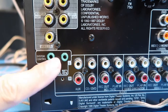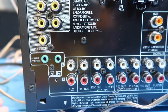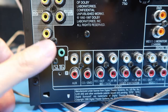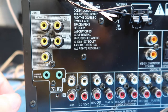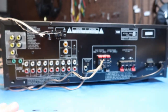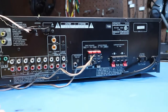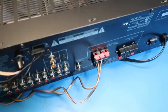We've got record out, and here's our composite video input and outputs — CD or DVD in, video 1 out, monitor out, video 1 in, and video 2 in. This is in the days of composite video before digital video. These system controls I've seen on other receivers — they amount to a way you can gang units from the same manufacturer together to operate under a single remote control, talking to each other through some kind of proprietary digital format. That's really not of interest in the modern era, but it made sense back then if you were buying a whole set of related components from the same company.